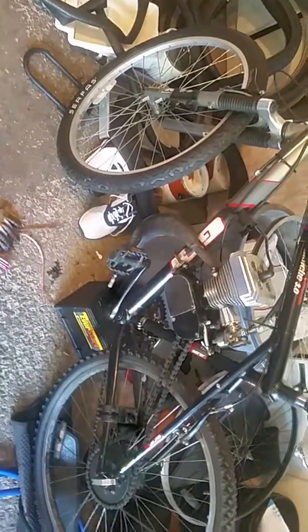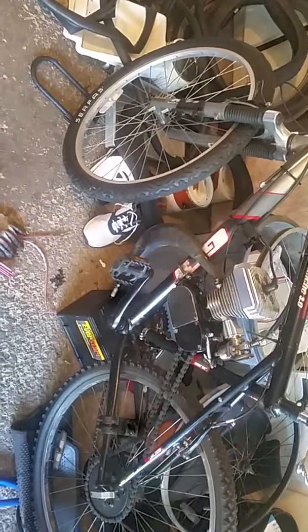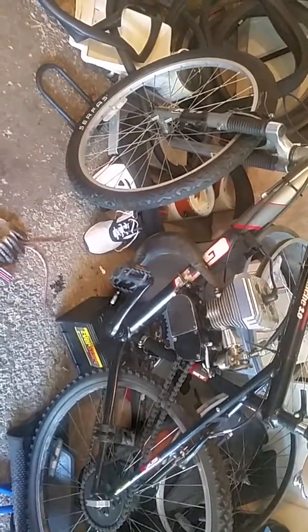So now I've got three bikes. This Schwinn is my new daily commuter. This other one is my fast bike — it has a window piston, OZ reed valve, high compression head, it's fully ported, and the cylinder is 47 millimeter iron sleeved.